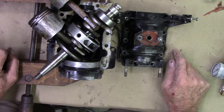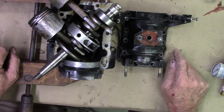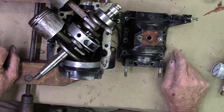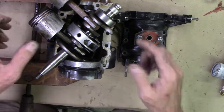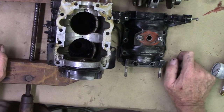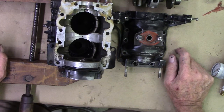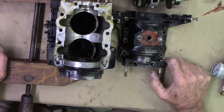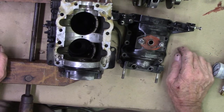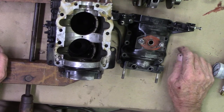So that's where I am right now — I've got some parts ordered. The reeds are stainless steel, but modern two-stroke engines like motorcycles and snowmobiles use carbon fiber reeds, available from a company called Boyesen. For $50 I ordered a set of carbon fiber reeds, so this engine is going to be totally high-tech when I'm done. This is a Mercury 1975 7.5 horsepower, and this video is also applicable to the 110 or 9.8 horsepower version — they're practically the same engine except for carburetor jetting and port size. I think I can bring this thing back to almost factory condition. Thanks for watching — this is Renaissance Al signing off.